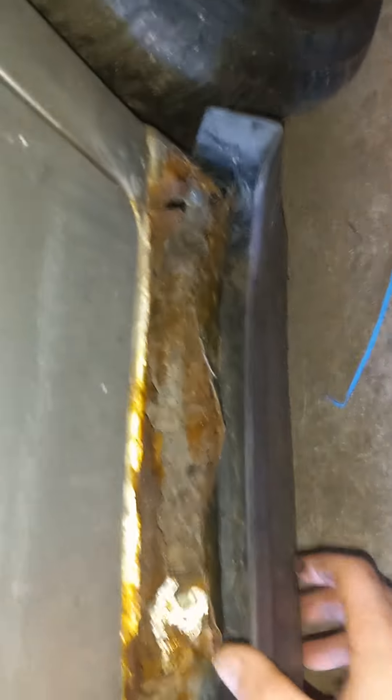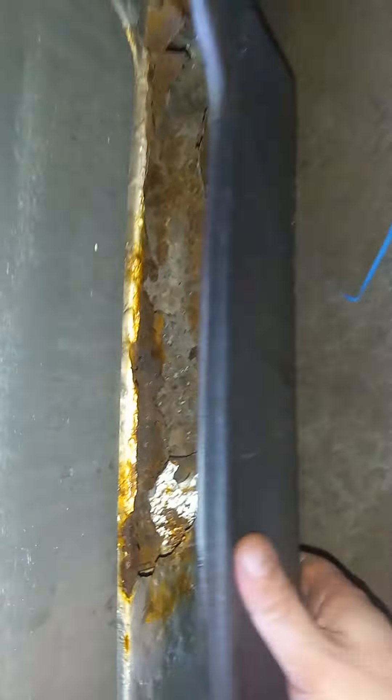Got a little bit of body rot here, nothing too major. I'll probably fill it with some spray foam and lift the side skirt back up, get a self-tapper in it, maybe hit it with the heat gun to make it a little flexy. Looks like the previous owner had a self-tapper in it too. My wheels are cracked and my rotors are rusting like crazy — it's just time to get this thing out and get her driving around again.